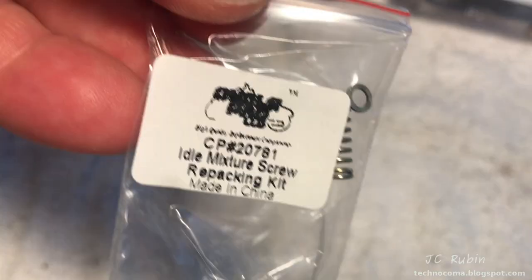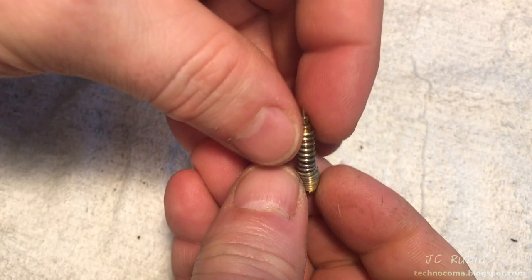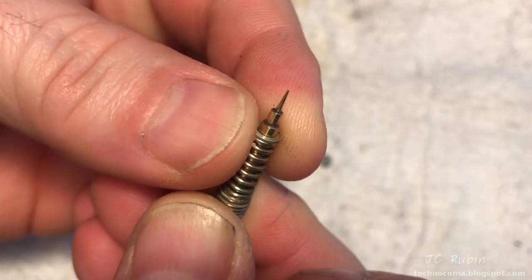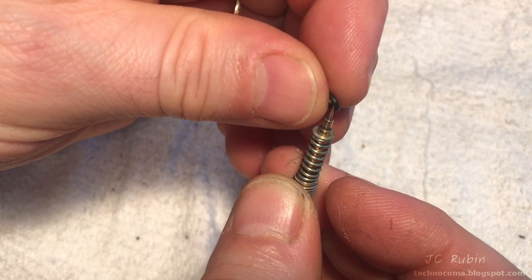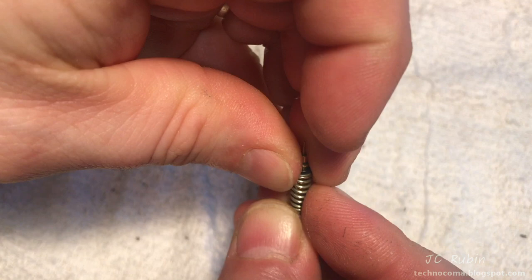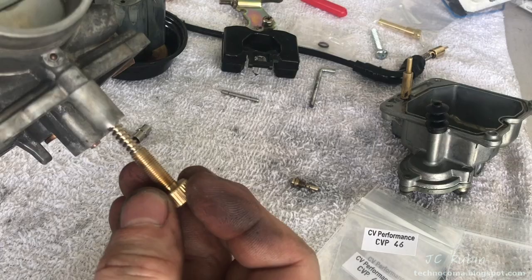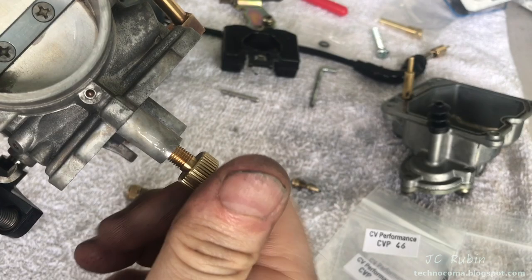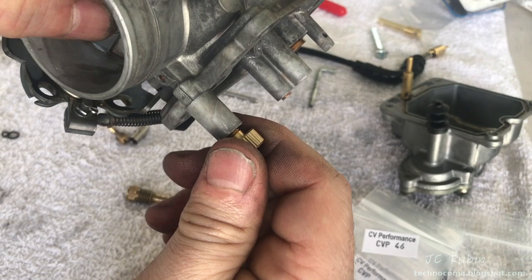Now unpacking the needle repacking kit ordered for the missing parts — there are three pieces: the spring, the washer, and the o-ring. Demonstrating on the old needle: spring first, then the washer seats over the largest diameter of the needle, then the lightly-lubricated o-ring seats just over the washer. Here it is all set up on the new needle. We'll turn the idle needle in until it stops gently at full seat — this should expose about two threads when done. I'll score the full seat position, then open the needle up one and three-quarters turns as a starting position.